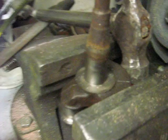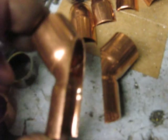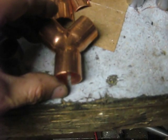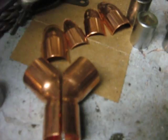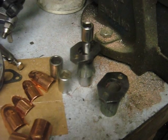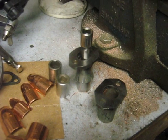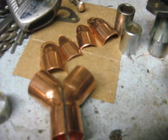You can see my Y here — you take a 45 elbow, cut a bullet-shaped piece out of it, and end up with a Y, so one into two. That's kind of the principle of my intake manifold. Anyway, just wanted to show you that — the intake manifold is coming along on the four-cylinder Briggs.